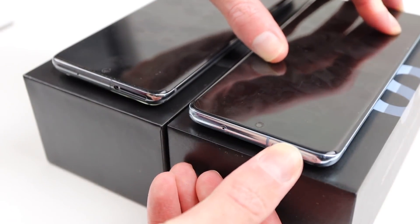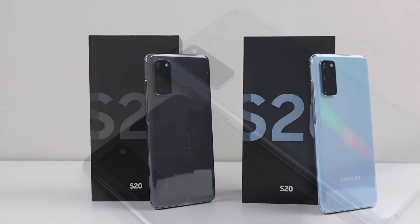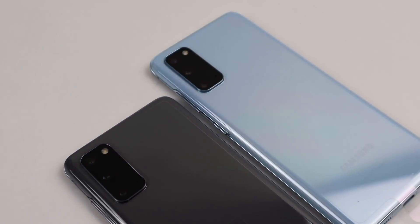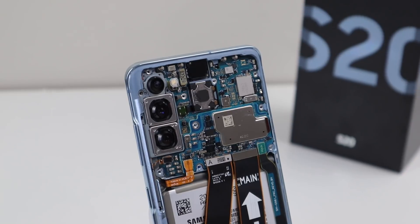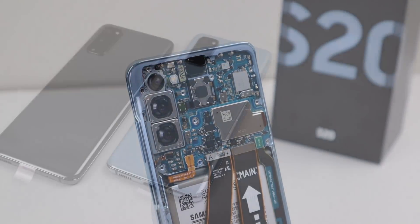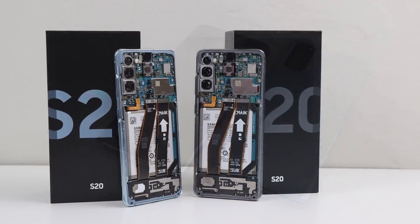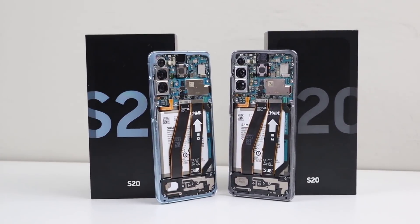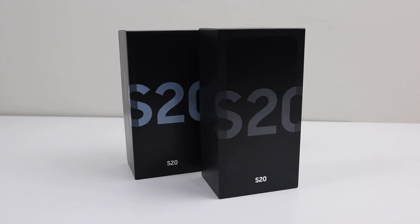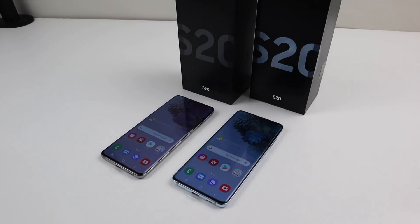After reinstalling the two SIM card trays back into the phone, we're done. So, how does the Galaxy S20 stack up in terms of repairability? It contains no paired components that prohibit DIY or third-party repair in any way, and important components are modular, although the battery is still glued in. Unfortunately, the back is also glued on — slippery and breaks easily. I wish aluminium or plastic-backed phones were still the norm, and even a replaceable battery would be nice. However, not all Samsung phones are created equal. There have been people reporting issues on the repairability of Samsung's A-series of phones, which I will be covering in a separate repair assessment video.